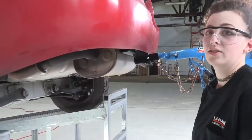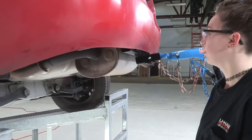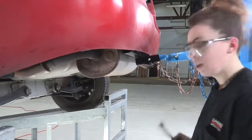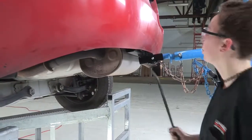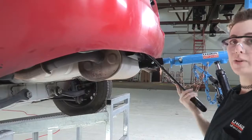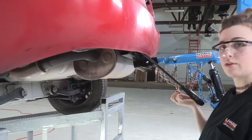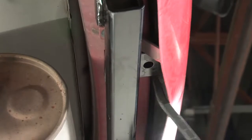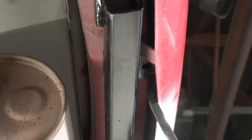The next two fasteners we're going to put in — we have to drill holes for them. We're going to use a pry bar and a drill to do that. We're going to use the pry bar to just pull the fascia back a little bit so we're not damaging it with the drill when we're creating our hole for the hardware. And we're going to use the hole that's already in the hitch as our guide for where to place the hole.